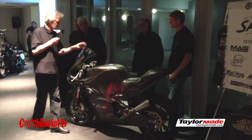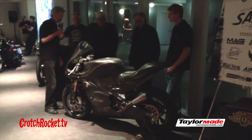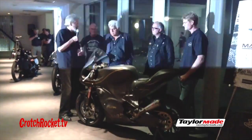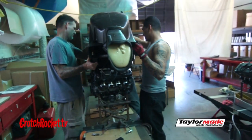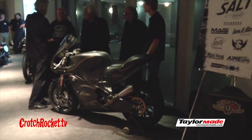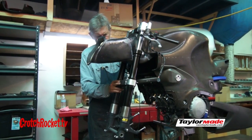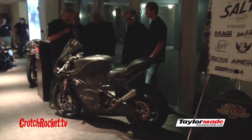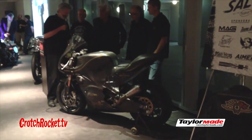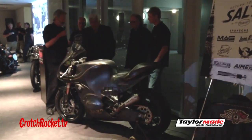And then there's a tunnel that runs all the way through the bike, through the gas volume, out to the radiator at the back. We did that because we wanted to keep the cross-section as small as possible. So the monocoque is only as wide as the engine itself. It actually has front suspension which is more reminiscent of the Broughs over here. It has a wishbone front suspension, and you may notice it has a very steep steering angle, and that allows us to put the tunnel through between the forks. It weighs 320 pounds, so definitely taking advantage of the materials and the design.